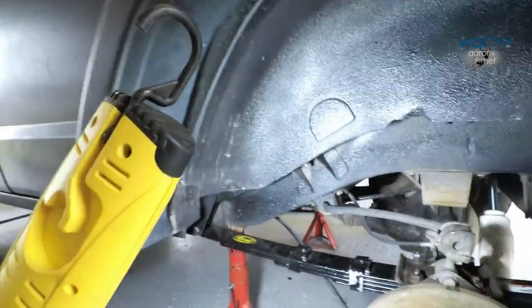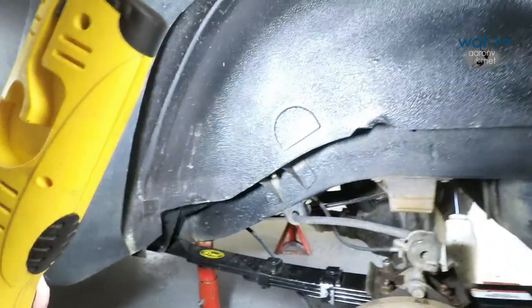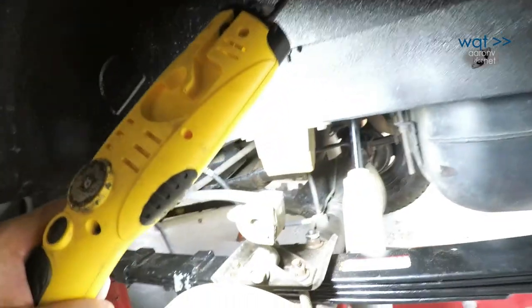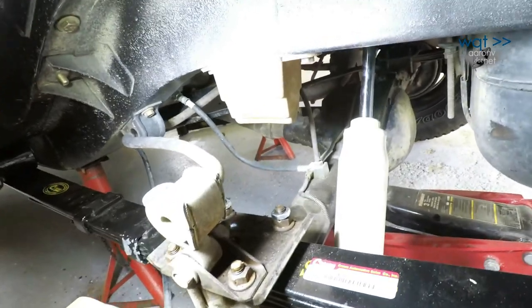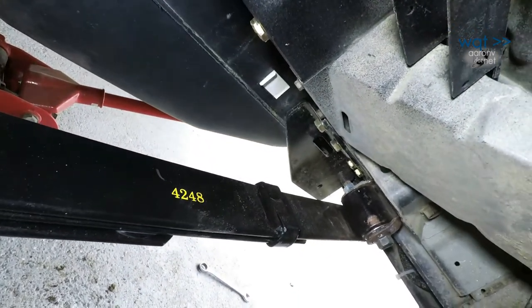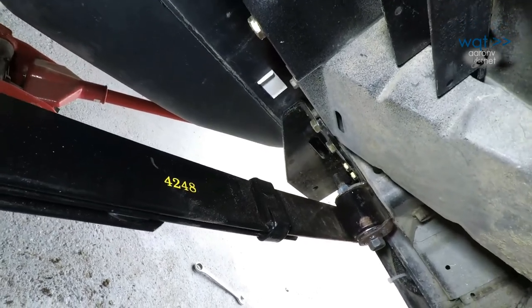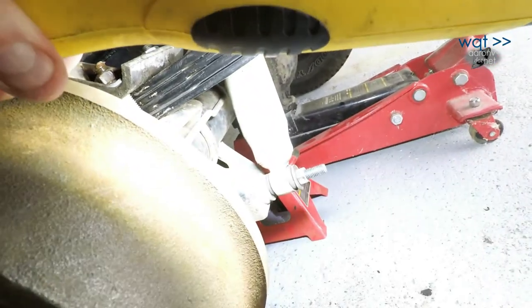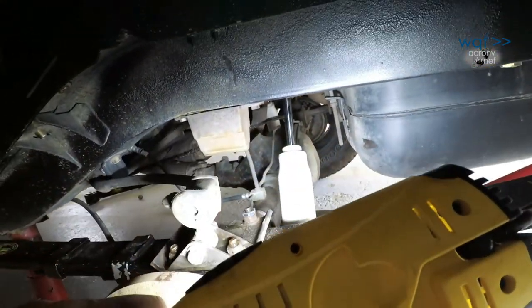Okay, well, there it is, one side done. With the benefit of experience, the other one should go a little bit quicker, but just to double check, we have four bolts retorqued there, and I added a pair of jam nuts on the rear U just in case. Bolt and the nut retorqued back there, those are freshly replaced. Bolt torque there, also freshly replaced. And then two upper and one lower bolts to mount this shock absorber, also done.